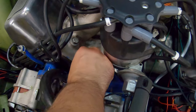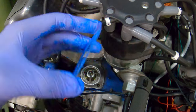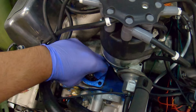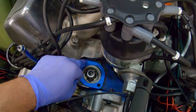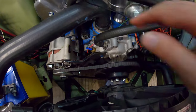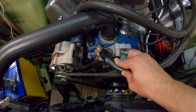We can chuck our thermostat in, like so. I've got our gasket here, which I've put a thin layer of ultra blue around. Whether you need ultra blue or not, I don't know, but I always put ultra blue. And doesn't it just get everywhere? All right, we're done — we've buttoned up. One of the cleaner thermostat installs I've done.